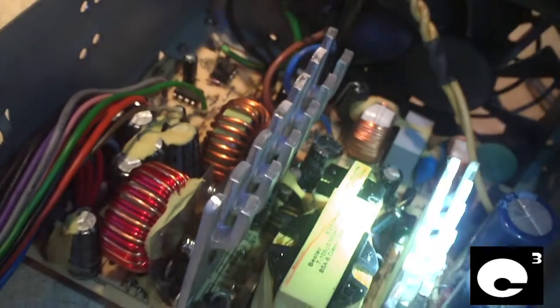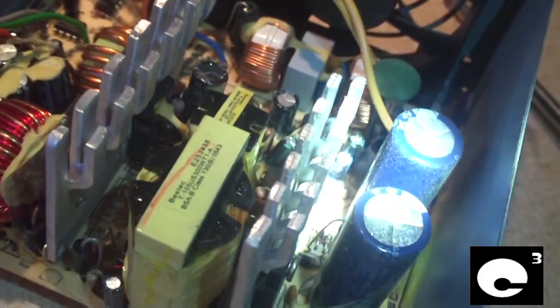It's not as component-filled as the HP version of the 300-watt unit, which I'll have a video on later, but it still works very well. The capacitors are decent — I've never seen caps fail on the 312E. The primary caps in this one are 560 microfarad, while the 250-watt units had 470s.